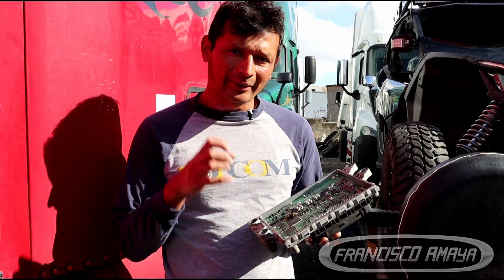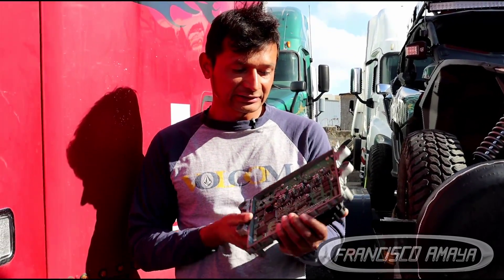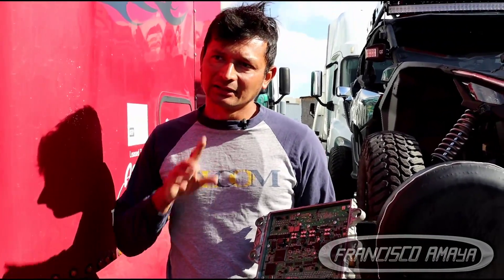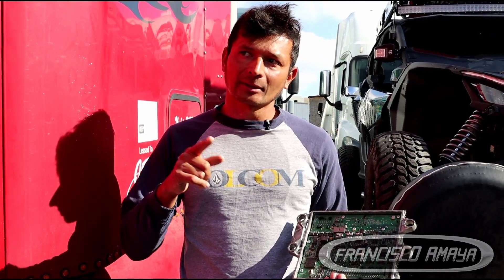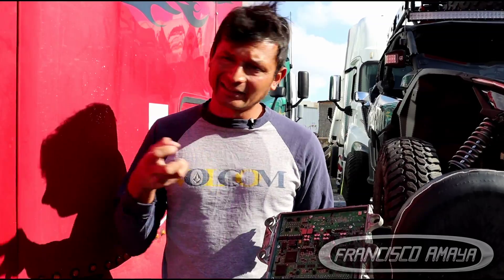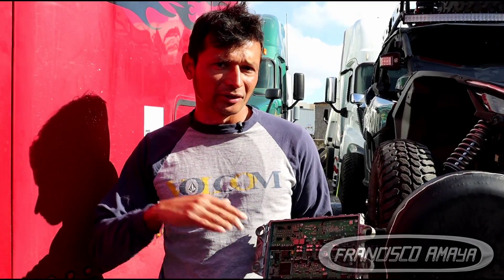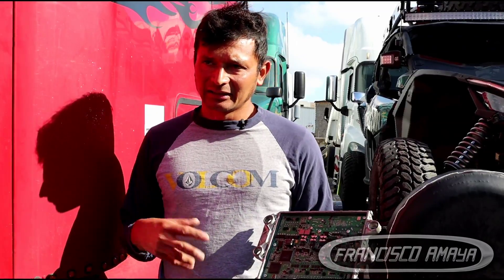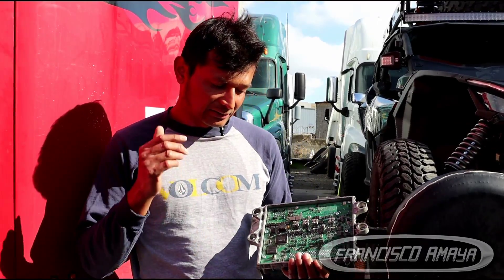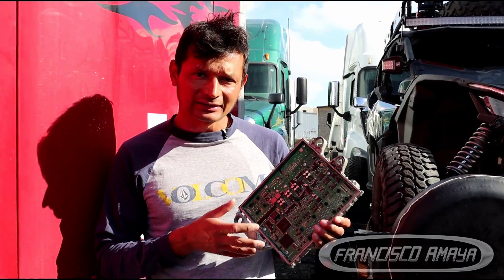As an example, a couple of months ago I did a video about another truck with a similar water damage problem. In that case, water got inside the cabin and destroyed three relays in the fuse box. The wet relays were causing the cabin power to go on and off intermittently. You can see that video on my other channel. The ECU case is harder and involves a more expensive component, making the problem harder to diagnose.